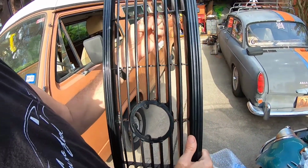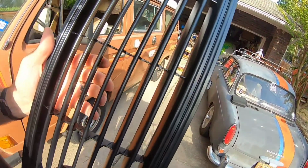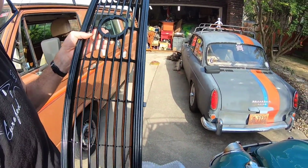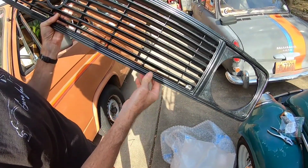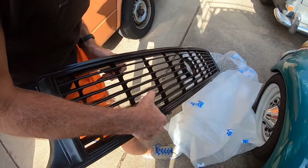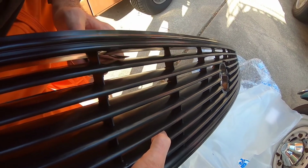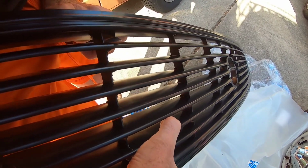Extras that you might want to remove. Oh, that's not good. That's not supposed to be there. And here's the little molding overrun. That stuff should be broken out. I may have to clean this up with a knife a little bit, a knife or razor blade, just something with a good enough blade. It should be thin where the lap is, so we can trim the extra plastic.